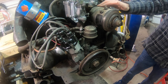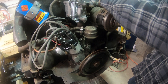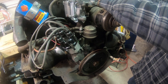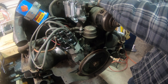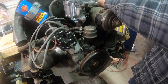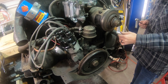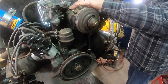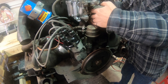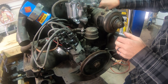I'm going to remove my generator strap. I'm going to be removing the big fan shroud at the back. I need to do that to get the generator and fan assembly off to replace it. As I mentioned, my manifold — you can see here the aluminum tape — that's where I was leaking. I had a vacuum leak, and as I mentioned, vacuum is critical on the semi-auto. So we're going to replace that with our new manifold, which doesn't have a leak.